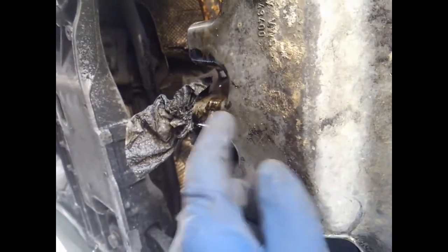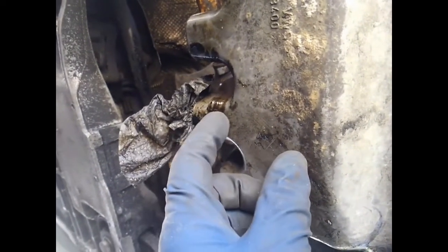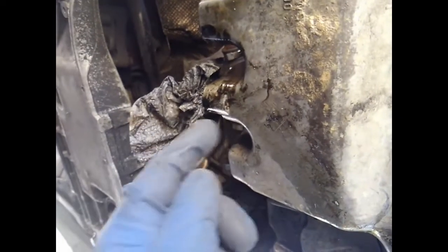I'll put on a different oil pan. I also had an insert kit with solid inserts like Time-Sert for my F-150, but the tap is too long to go in — the threads only go straight and then it goes up into the pan, so I can't use a tapered tap with that insert. I was going to try to do that but it didn't work out. We'll pull this out and get a new oil pan in it.